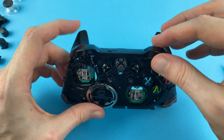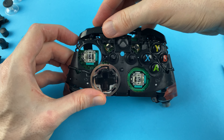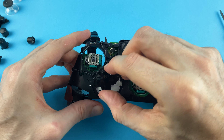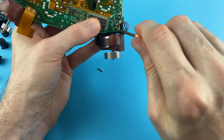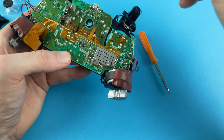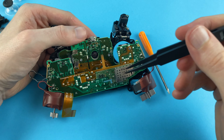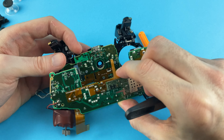We take off the thumbsticks because we're replacing them. The next thing we take off is the shoulder bumpers — remove that very top component and then the shoulder bumpers will just pull off. We then take out the sync button by pulling it upwards, and then remove the ring around the D-pad which allows us to remove the D-pad. Now that we've removed those, it's time to take out the main circuit board and face buttons. Flip the controller over and unscrew the two screws at the bottom of the circuit board. Then remove the smaller circuit board from the main circuit board by pulling the little black cable off from the middle, folding the cable back, and pulling the board away — it's also connected underneath so just give it a firm pull. If you don't have a lofty remap kit you won't need to worry about the extra ribbon cable here — that's only part of the lofty remap kit.